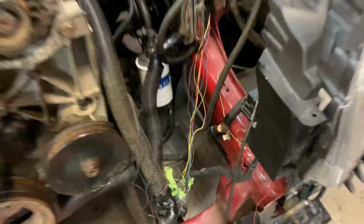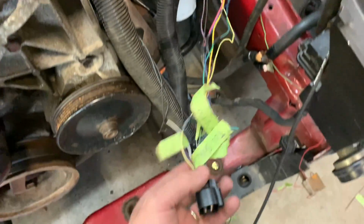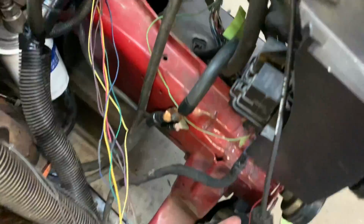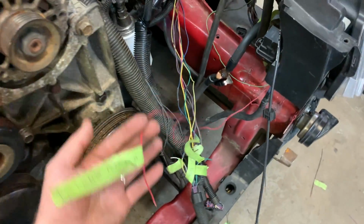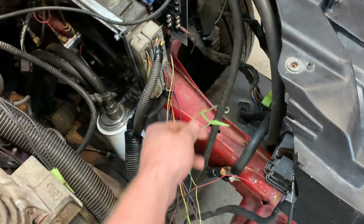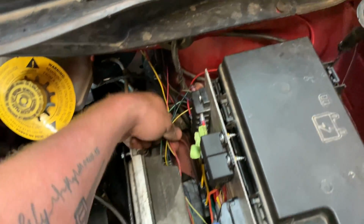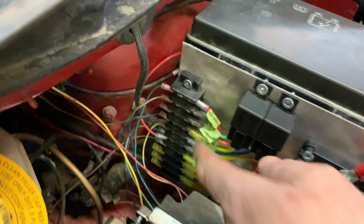Lots of wiring getting done tonight. I'm starting to get my outputs all done. The only thing I have left now is a TCC brake switch and the electric fan output, which only has to run right here. I think this one is fan control. Yep, that's it. So I'm just gonna connect that one across to here, run my 12-volt power up to the fuse block here. I'll crimp another connector on, make it look a lot cleaner. And then I've got to loom up all this wiring back here that runs to all the spots on the fuse block there.